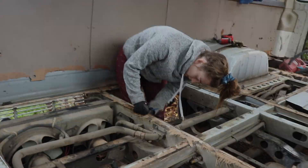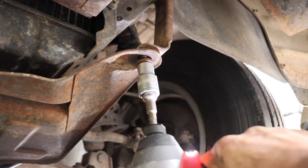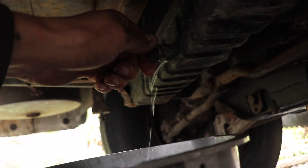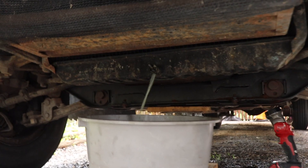I disconnected the heating units in the floor, and while they were out because we were draining the cooling system, I took the opportunity to flush out the whole cooling system through the block and the radiator. I just disconnected all the hoses and everything, and then just flushed them all out with rainwater.